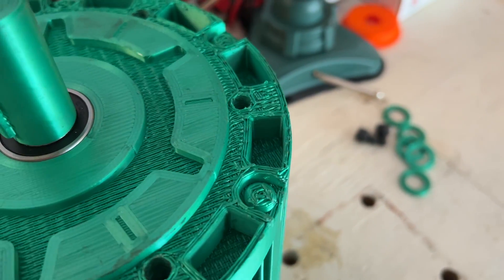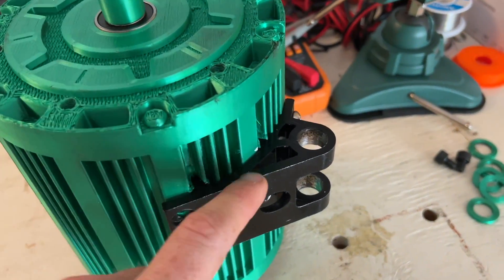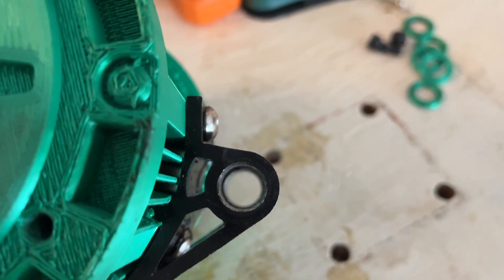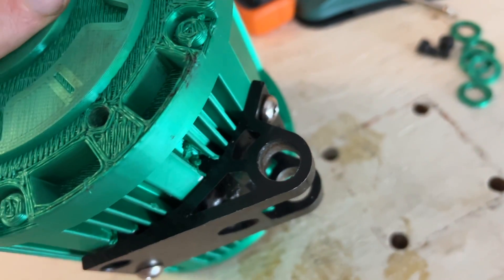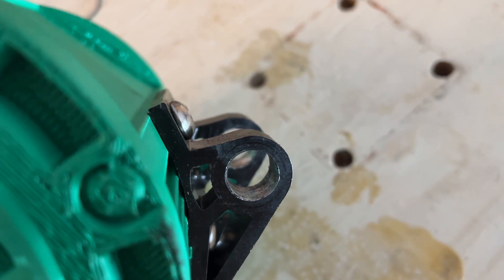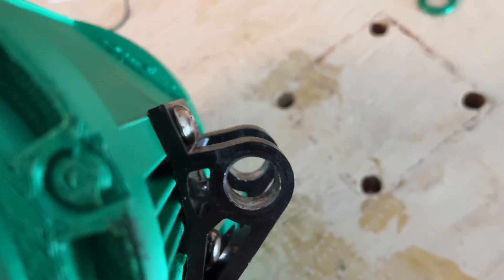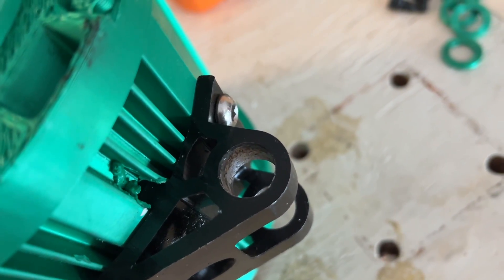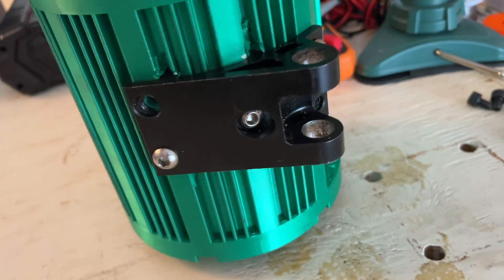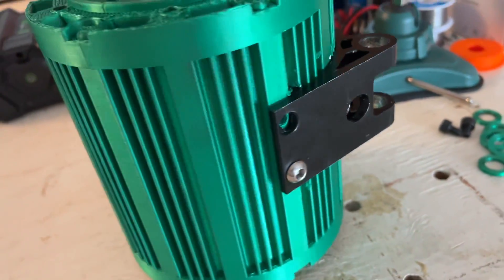Here's the motor — all the features look pretty good. These screw holes I modeled so they actually have threads in there, and then I ran an extra tap on them to actually make the threads work. This is the original mount that comes with the QS 138 motor, and I bored this out to about 15 millimeters to fit the shaft that I'm going to mount on the bike. Not the cleanest cut — I had a bad drill bit, so regretting it a little bit — but it does work and as you can see it attaches pretty much perfectly to the mounting points.